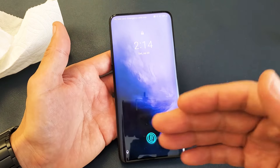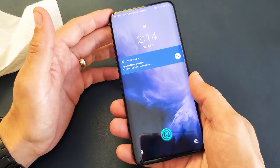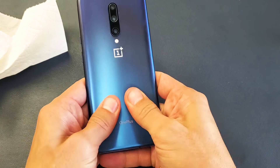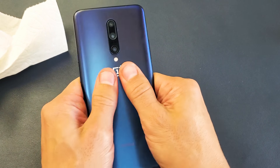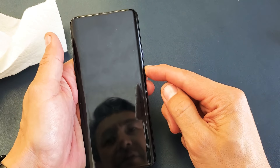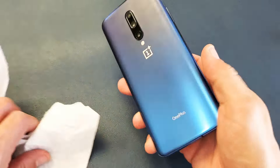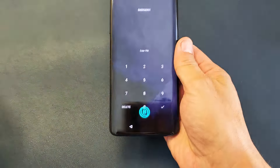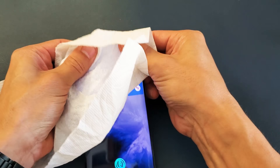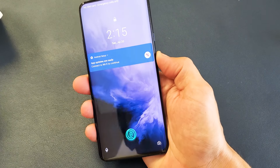For the next step: it's possible that you have a ribbon cable that's dislodged slightly. What you can do is turn your phone over and press all over the back of the phone with your two thumbs — put some pressure on it, go all around the lens. You can also grab a paper towel and do the same thing. Then go to the front screen and press, giving it a little bit of pressure all over, and then try to power it on and see if you get anything.